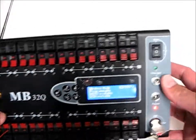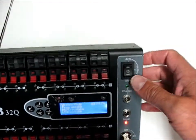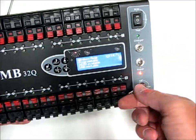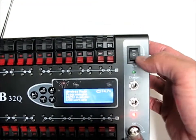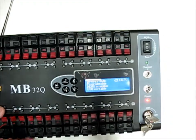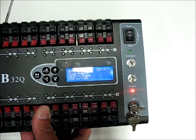On the module itself there is the program position, which is the off position, there is the test mode, and the arm mode. To program this module to a remote, we would have it in the middle off/program position. There are a couple of ways to program a module to a remote.